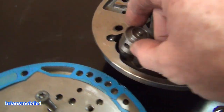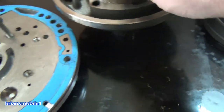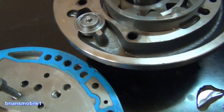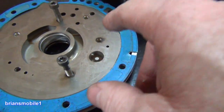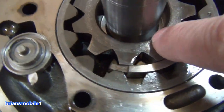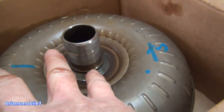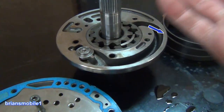Speaking of the force — this is literally a flow control valve, that's the name of it. It's got two little openings, and it's split in the middle by this little island right here. It comes around from the pump. You have this in here and your torque converter comes in through the other side — this is the front door of the transmission. The torque converter comes in through here, centers up in the pump, and drives it because there's a little notch here and here that corresponds with the notch on your torque converter. But if this gets stuck open, it's just like a balloon with a hole in it.